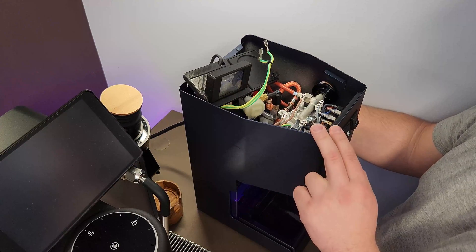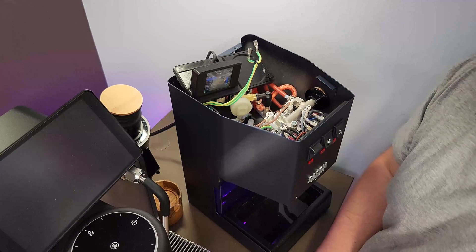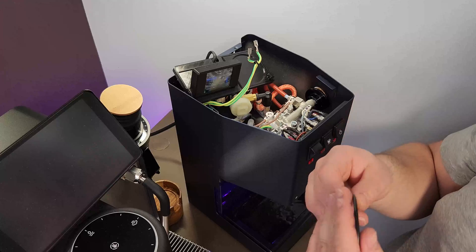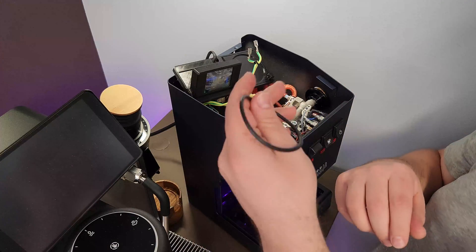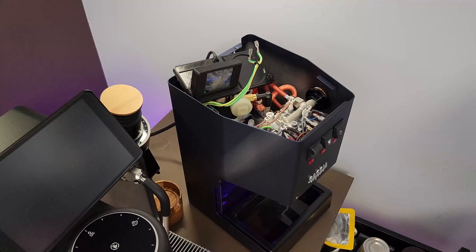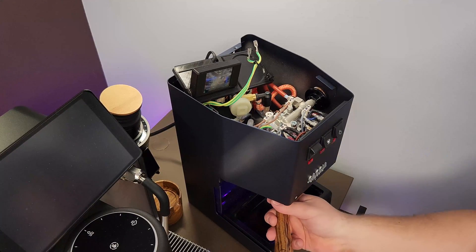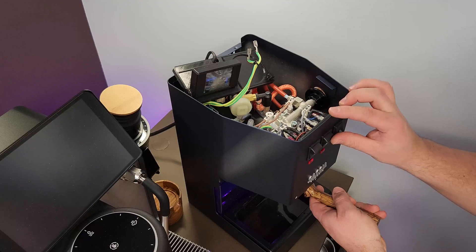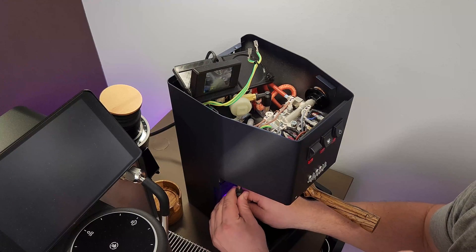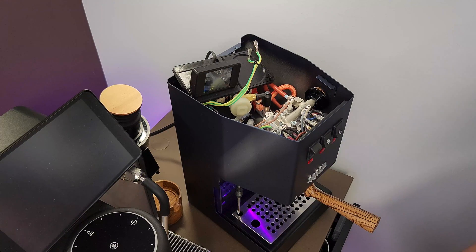Or maybe even a shot. I mean, you typically use 9 bar for espresso, so if it holds 9 bar then it's good. If it's not going to hold that, unfortunately I'm going to have to take it apart and put the o-ring back, and also use the silicone to separate the two metals. So far so good. I think I can just put in a blank and see if it holds the pressure. This is probably the ultimate test right here. I've got to do this discharge too, so it doesn't pump.